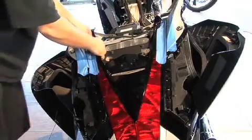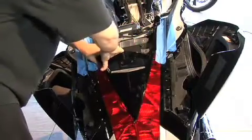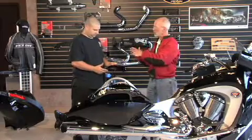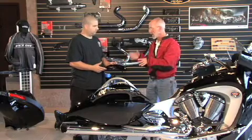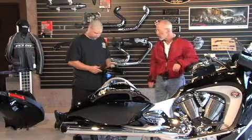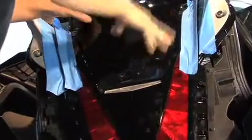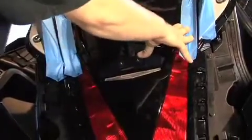The body panel is held on with automotive-style body clips. Start at the top and pull directly up toward you with just the leading edge to loosen the four connectors. Note: if you bought your bike with the trunk already on it, you won't have this filler panel — it's sold as an accessory from the dealer. If you bought the trunk separately, it was already on your bike. To install, tuck the lip in the back under the trim piece, seat the automotive clips in their locators, then snap the trim piece back in working from the bottom back to the top.